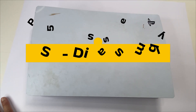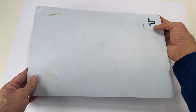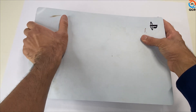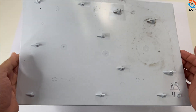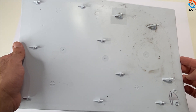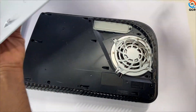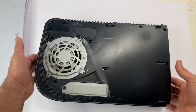Opening our PlayStation 5 console, we'll be starting off by removing the side panels. Look for this PS logo — lift up this side from here and slide it to the left. For the second side panel, lift up from this side as well, lift up, slide to the left. This console requires a full service clean, so grab your low-power vacuum cleaner and let's clean it up.